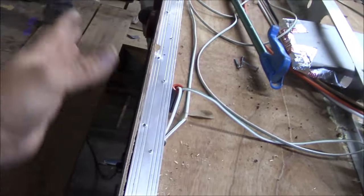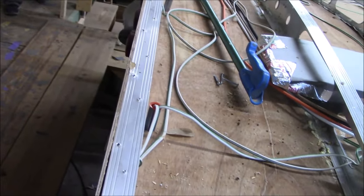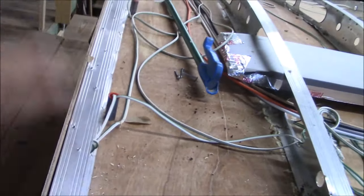If you look at this, there's a gap here. There isn't one there. We'll pull this truss back a little bit so we'll get that balanced out. That should have been done, because that wall moving like that could really be a problem down the road. Eventually. I don't think it would be an immediate problem, but you want everything secured and glued together, and they just don't do all that.